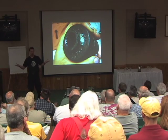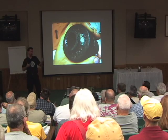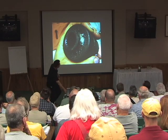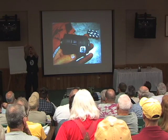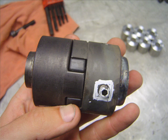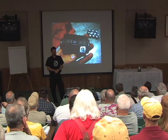A Lovejoy coupler is one of several different types of couplers — a way to connect a shaft of one size to a shaft of a different size. You can probably see it better in this photograph: it's two parts, three fingers, and it just goes together like this. So this part goes between the drive shaft of the motor and the driven shaft of the transmission, connecting the power between the two.